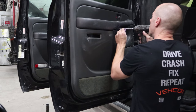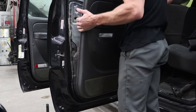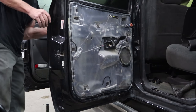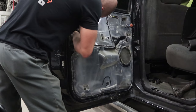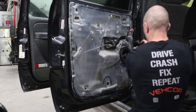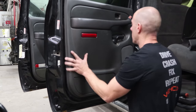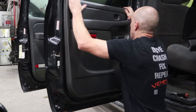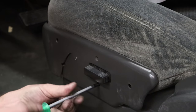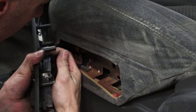Now we're onto the rear door — this one's actually missing a handle. I used it for that 2005 Chevy that had the rusty floors, so we'll put the parts truck one in. While we're here, put some wax in the door seam. Our parts truck had a set of aftermarket rear speakers, so we'll throw those in since the speaker didn't work back here anyway. Slide the door panel in, bolt it in and clip it all in. Now the trim around the seat controls is broken, so we're just going to swap it out — pretty easy, just five screws.